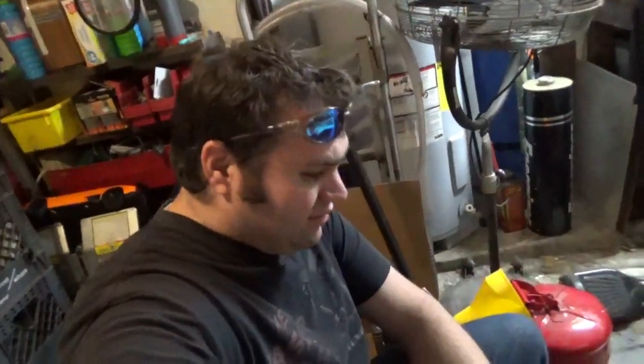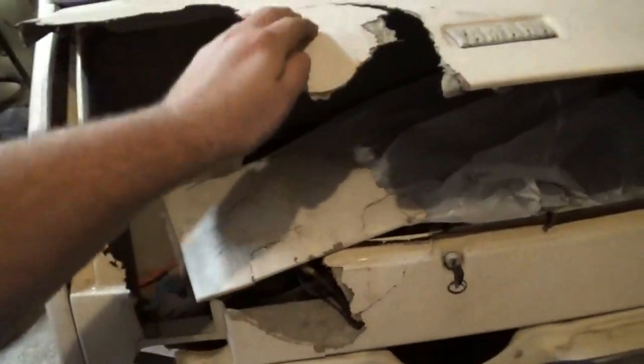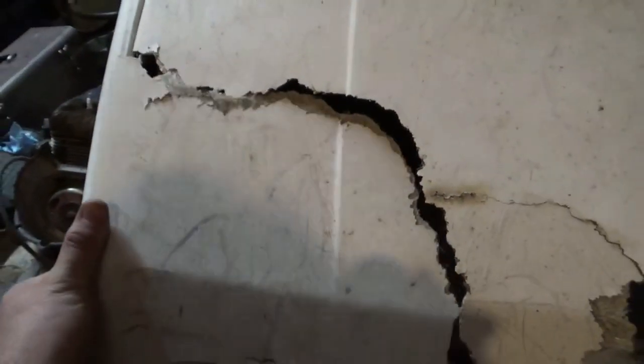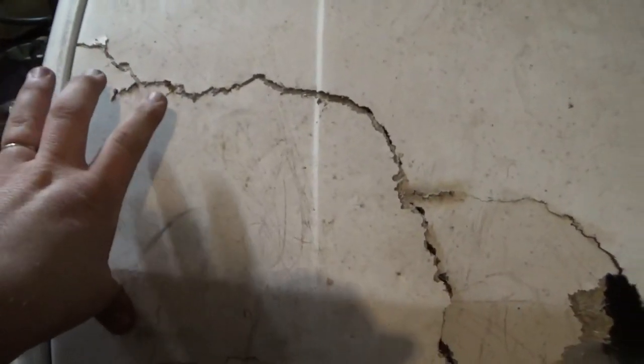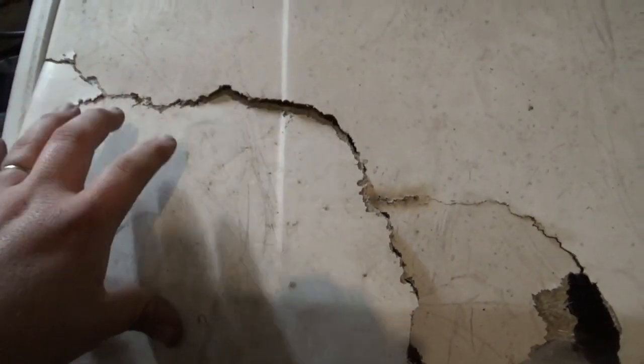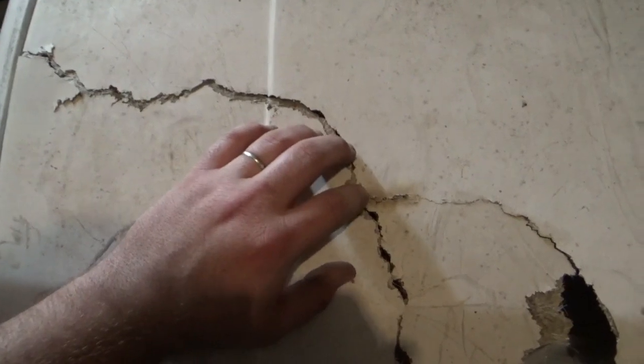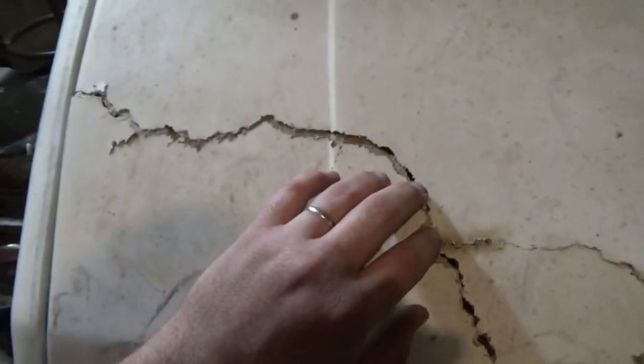Today I'm going to be trying to tackle some of this horrible fiberglass damage. I have most of the pieces, I just need to figure out how I'm going to brace this to try to fix it. They do fit together decently well — the cracks line back up somewhat. If I can brace it together, I can fill in the crack with some resin, flip the hood over, sand it down, cut into it, and lay new fiberglass mat underneath. For the surface, I can use Bondo Glass, which is a fiberglass-reinforced body filler.